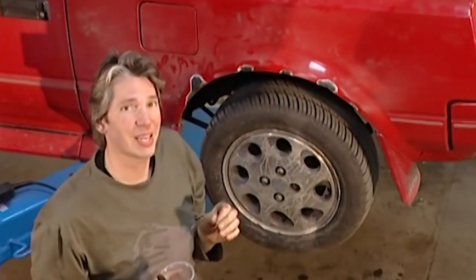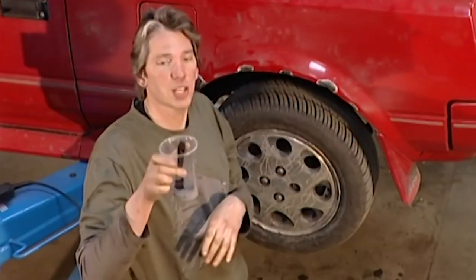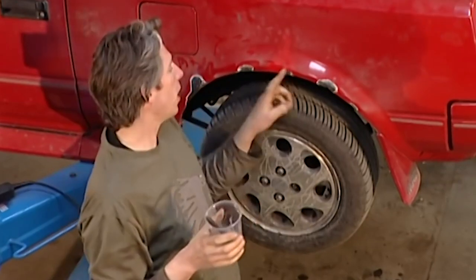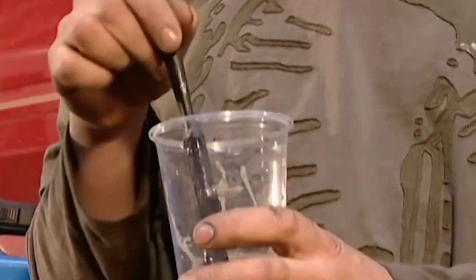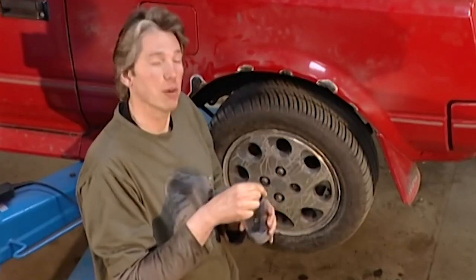Now for the science bit — and more specifically, chemistry. I've already ground off all the big flaky bits of rust but there is still some in the bodywork. I've got this rust remedy, which is a magic chemical you can get from any automotive supplier. Very simply, it chemically changes the iron oxide — which is the rust — into something firm and hard that I can put filler and then paint onto. You just dab it on with a paintbrush, leave it about 15 to 20 minutes for the chemistry to do its stuff, and then it's ready for filler.